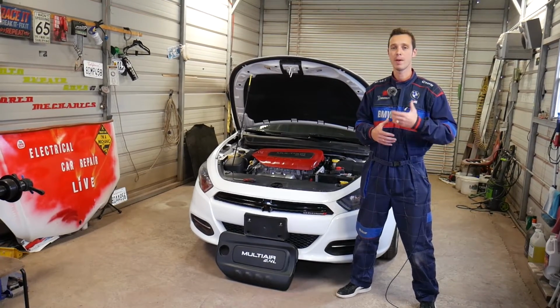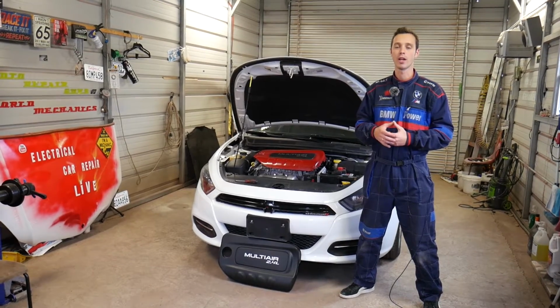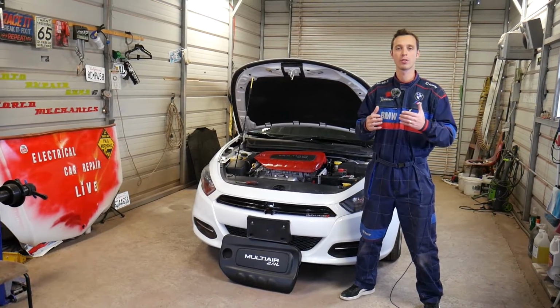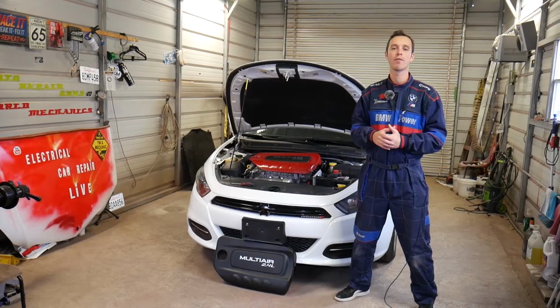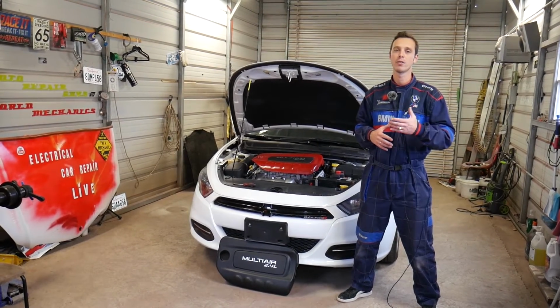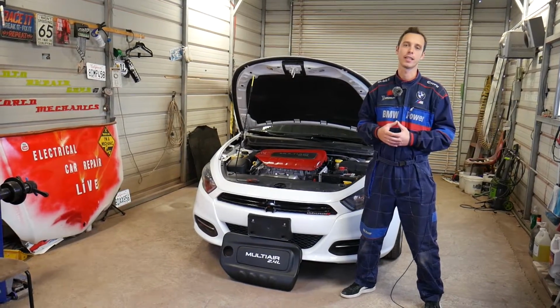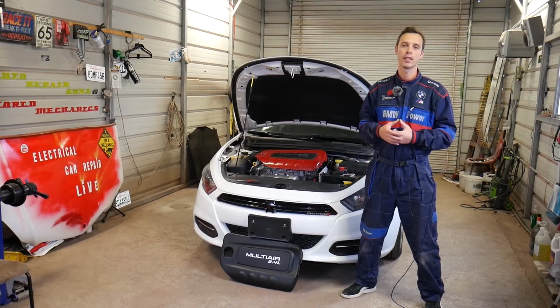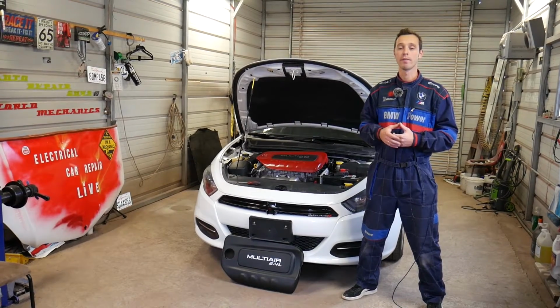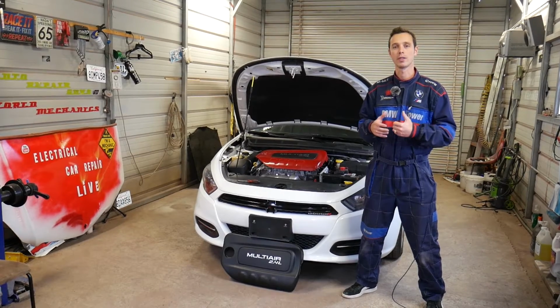Now, if you have a bad PCV valve, we'll explain what you can expect and how to detect that you have one. That little device costs only a few dollars to replace. Most people, I would say 95% of the people, never ever think about replacing it, and that thing can lead to so many problems. So what we usually do, I replace it every 60,000 miles, to be honest with you. Replace it so I don't need to worry about it. Even some manuals suggest to do that, so stay with us and we'll explain all the symptoms now.